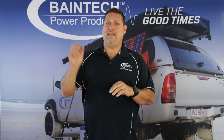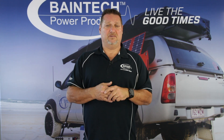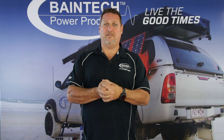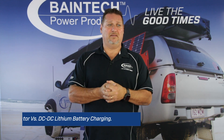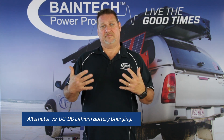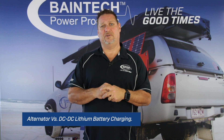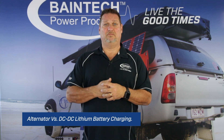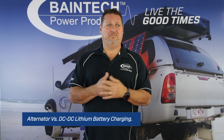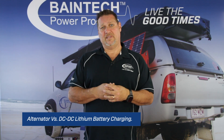To put all that power back in within an hour is definitely not required. Lithium batteries charge up quite easily within a couple of hours if they're at 50%, with most DC chargers these days. Yes, you can charge a lithium battery from an alternator, but we definitely don't recommend it — there's a lot of evidence out there to suggest not to. Even guys selling beefed-up 200-amp alternators for 200 Series Cruisers and alike — sure, it's great to get 200 amps into your 200-amp battery, but you don't need to charge it in an hour. Putting 30 to 50 amps into a battery over a couple of hours is more than enough for most people traveling between destinations.